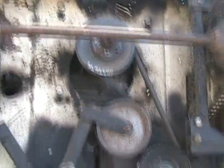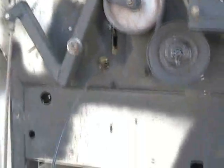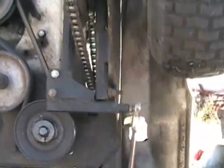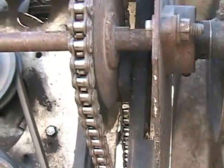Here is the undercarriage of my Cub Cadet. I got a slight overdrive, almost one to one pulley ratio. And this is my clutch here, this is my brake. I've used it on two tractors so far. You pull it, it squeezes, and I welded two truck brake pads in there. It works pretty good.